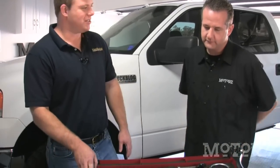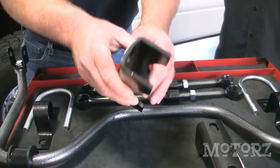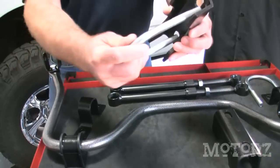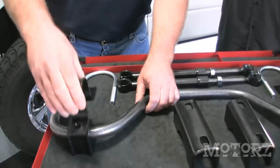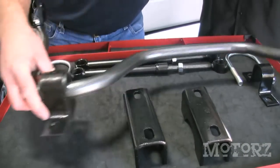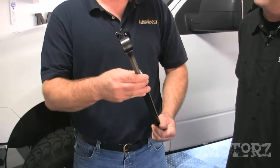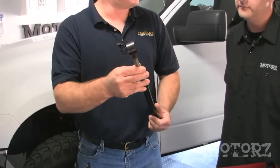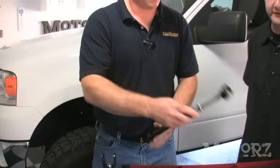We've got everything laid out on the table — tell us what we're looking at. We've got the basics here. We have saddles, which allow the sway bar to be mounted onto the axle. The saddles are attached with U-bolts that go around the axle through the holes in the saddle. The sway bar is attached to the saddle by putting a U-plate over the bushing. To attach the sway bar to the frame, we have heavy-duty adjustable end links. Since this is a lifted application, we need a longer end link — these are adjustable in three-inch increments and can be mounted to the clevis bolted onto the sway bar.